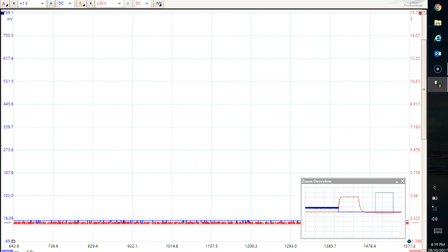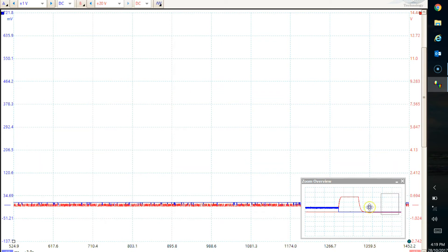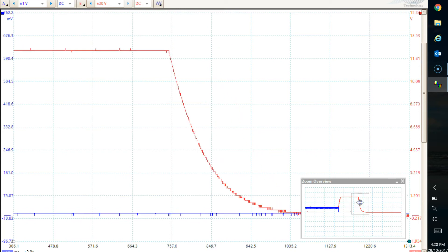If we scoot along, at the moment the whole thing is just priming up. Going to the second screen — this is the tail end of it priming, so the fuel pump is still running here. The circuit's put to ground by the ECU, so we've got basically zero volts. Then the ECU disconnects the circuit, and you can see the red line bounces back up very quickly to battery voltage — 12.37 volts, obviously down a little from running the pump. The current flow through that motor ceases as soon as the circuit's broken, going straight to zero. And then finally, this is the point when I turned off the ignition switch — loom voltage plummeted to zero.